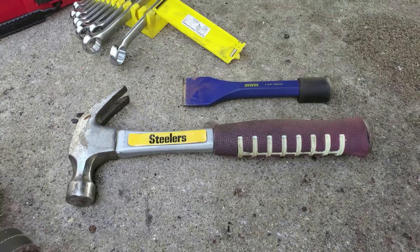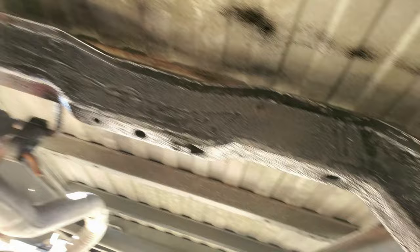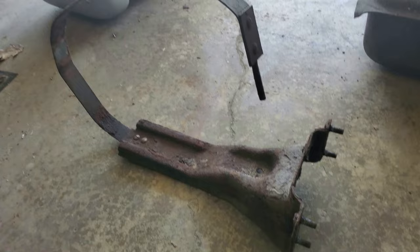There's a ton of rust above the gas tank. I pounded out some of that rust with a hammer and chisel, then sprayed fluid film black over the area where the tank will cover. While the nuts on the fuel lines are soaking in PB Blaster for a third application — they are really seized up — I'm taking advantage of the access to treat the rusty spots.